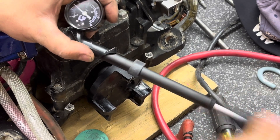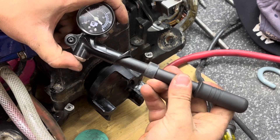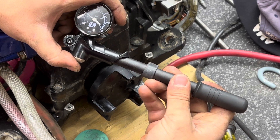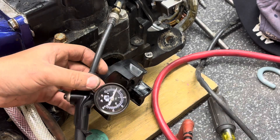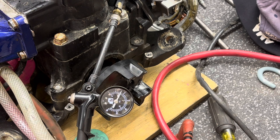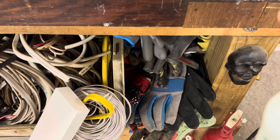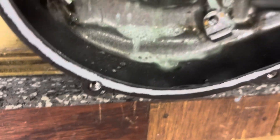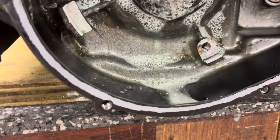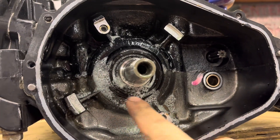I'm right at about eight PSI. You set this down in one spot and you can either walk away or look at the motor. What I tend to do is take Simple Green or something with a bubbly liquid and spray it on the motor. And as you can see, it's bubbling up right there, which means we have a leak. It's actually bubbling up in two spots right on the edge of the crank — pretty bad.